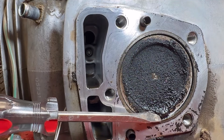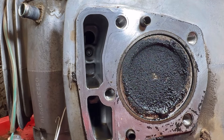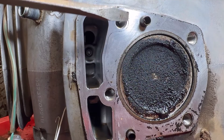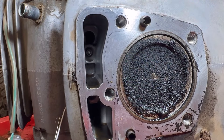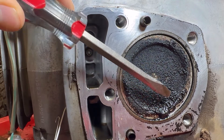I don't know if that's just carbon buildup. The owner of this mower just runs fully ethanol gas. This is part of the reason why I say run ethanol-free gas, because this stuff just builds up in here. Also, this mower's got about 400 hours. So when we start, the first thing — please do this — when you clean your piston, bring it up to the top of its stroke and clean it there.